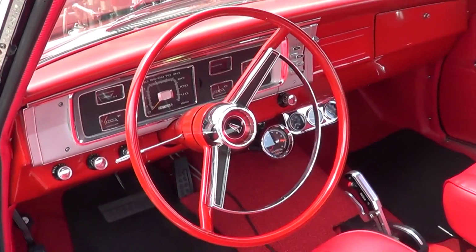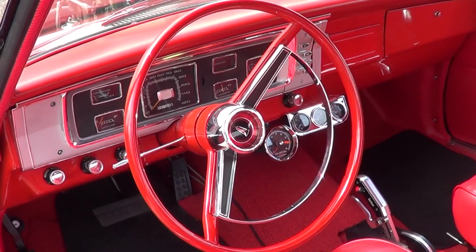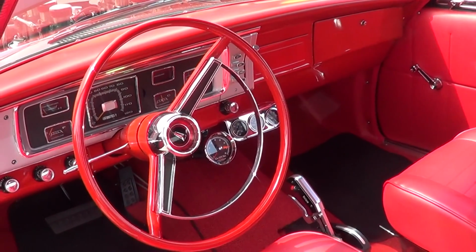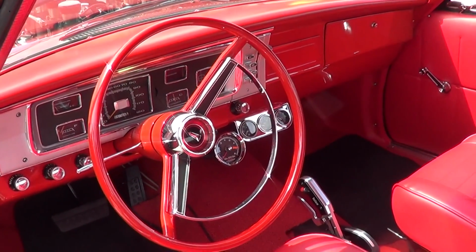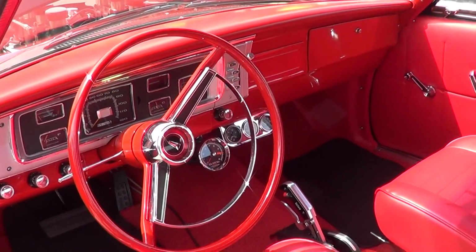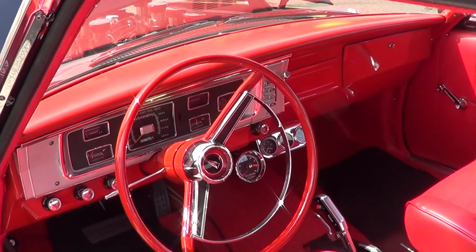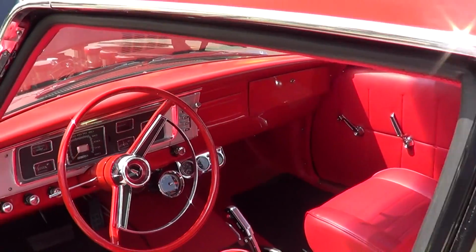I've got a dual wideband hooked up to this car so that it reads air-fuel ratio so that I know where I am. And the only bad part about these Webers is you have to tune it for the season. In the wintertime, it takes different jetting than it does in the summertime for WOT. I got you. Now, idling is fine, you don't have to change that. But for wide open throttle, you have to change the jets. Do you have to do it from spring to summer, or is it just a major switch from summer to winter? Just a major switch. I don't really drive a whole lot in the summertime. Too many bugs. I like to drive the cars in the wintertime. Down south, right? That's one of the beautiful things about living where we do.